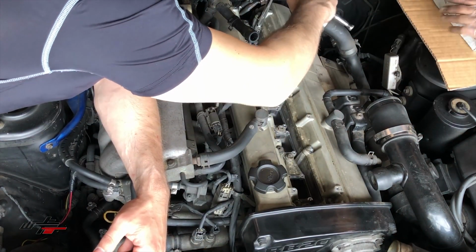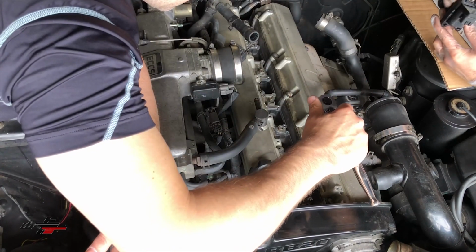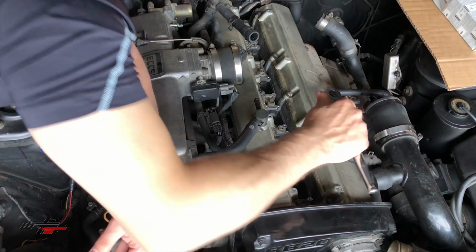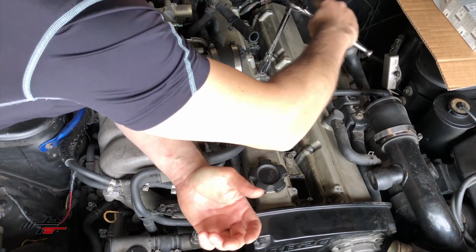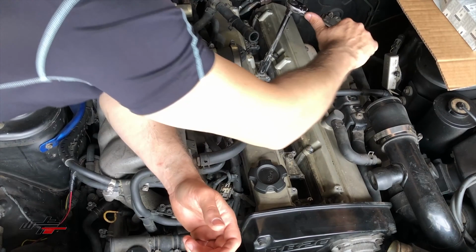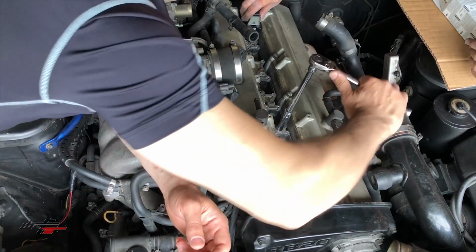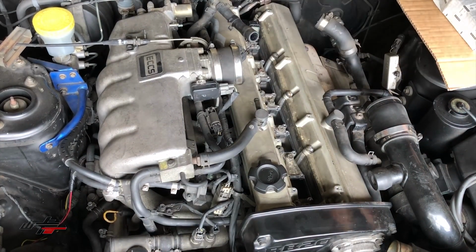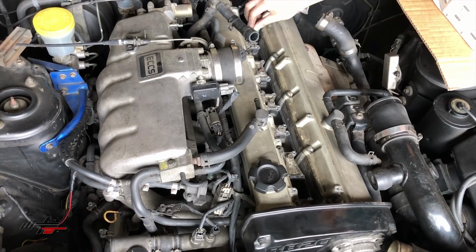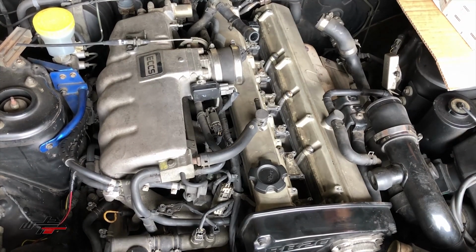Beauty, look at that, brand new Hanshin coil. Exactly what came as original, but they'll last another 30 years of driving, so very happy to see those there. And then I'm gonna drop one of them in cylinder number 6 here and make sure the orientation is right so that they only fit in there one way, and we're gonna replace the screws that came off them just like that. So screw number 1 has gotten started.